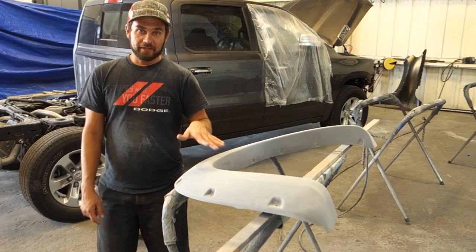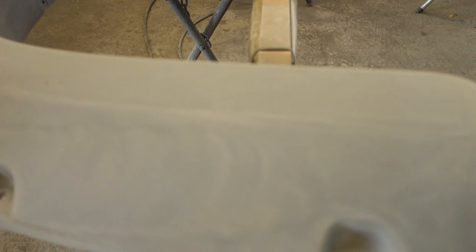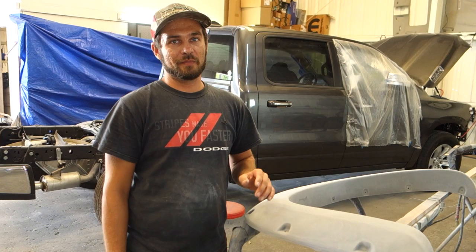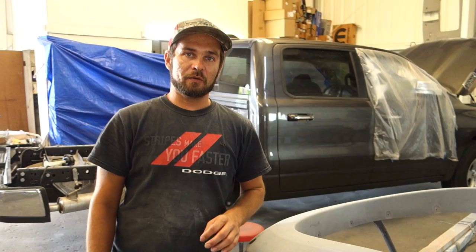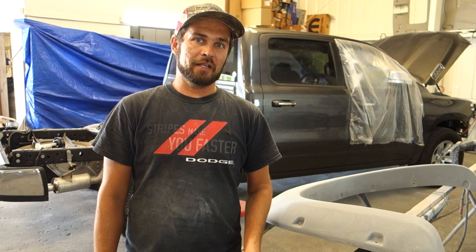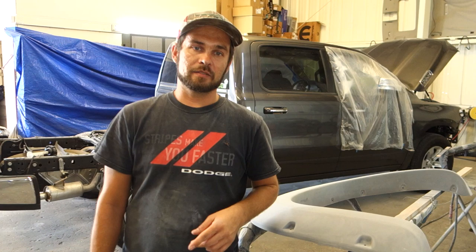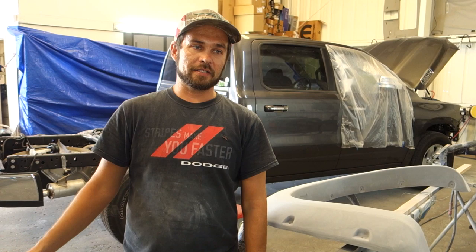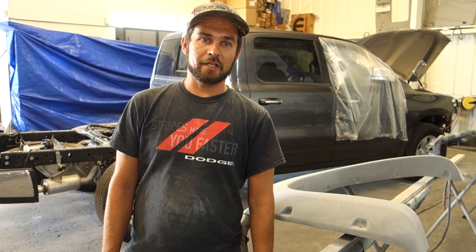Finally got these flares all sanded out because they were textured — that's the only thing that was available for this truck. We got all the primer sanded out. It took me pretty much a whole day just to get four flares, but I wanted them perfect so I had to take my time especially getting in all these grooves. That way it's a hundred percent once we paint it and we don't have to worry about anything. Right now we're going to get the truck outside, give it a nice wash so we don't have any dirt when we paint it, wash the flares, and then we've got to sand the bed skin that we replaced. We're going to be painting the door jams, the bed, and the flares, so we've got to get all that stuff ready and cleaned up.